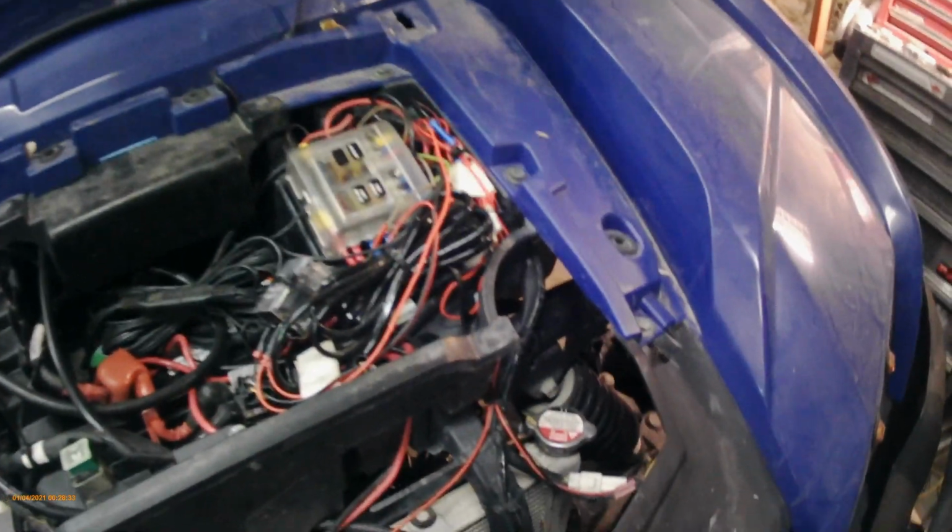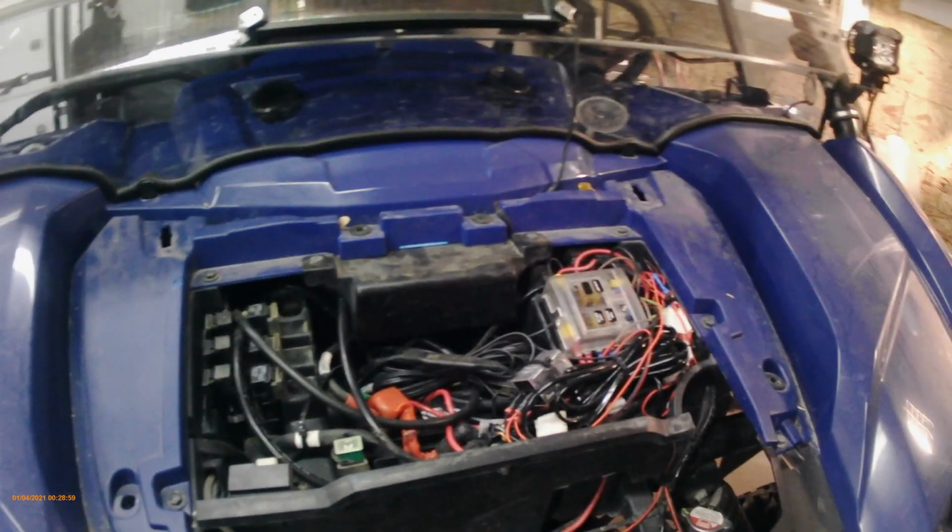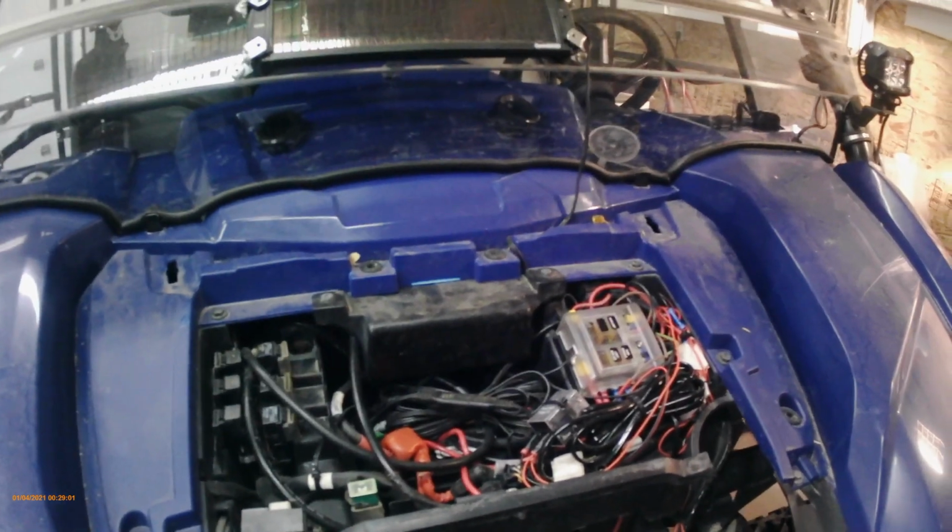Now they say you're not supposed to start it up. You're supposed to bleed it, go back to the engine, and so on. But anyway, I have some experience with cars, and it's pretty much the same as a car. You're up on the ramp, so it's up about 10, 12 inches. So you just take the cap off, fill it up with antifreeze, and I got as much in there as I could. You let it sit and let it drain down. Start it up.